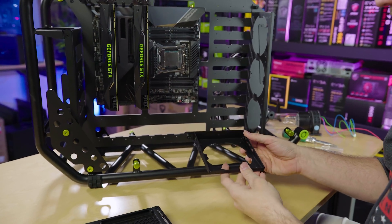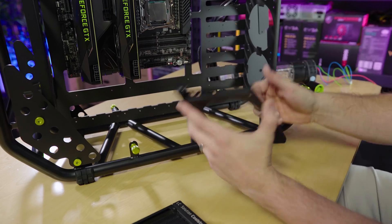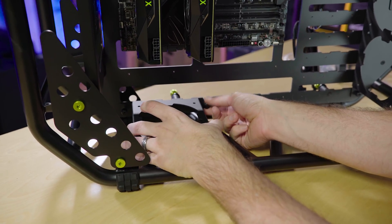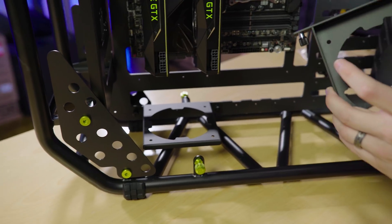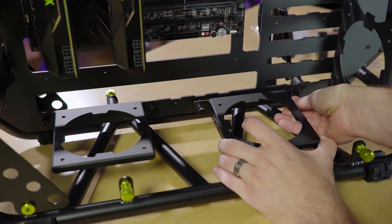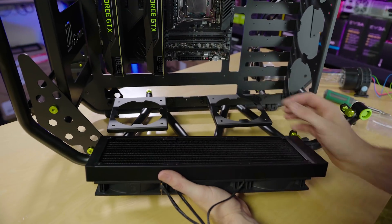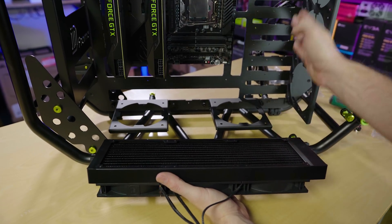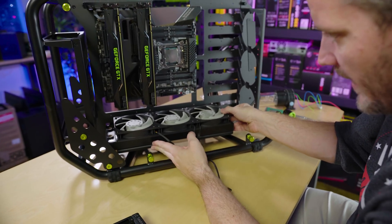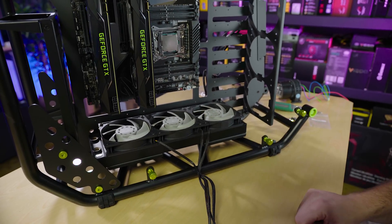What we're going to do is take these two split brackets and flip them over upside down, because we can't mount fans on that side. We flip it over so it's flat, then line it up where we need it. The hardware on this case is premium — spring-loaded thumb screws with a retention system so they don't fall out. We take our 360 right here, and you can see the holes will line up. We can get four holes per bracket, but we can't slide it any farther forward without interfering. That's exactly why we do this test run now — so I know exactly what I can fit in here. The 40mm will fit with these fans, but there was no chance of getting horizontal mounting.